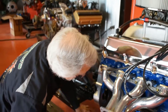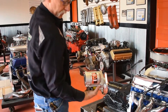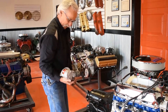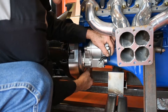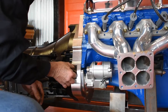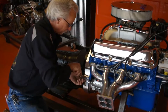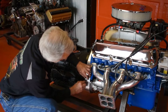That's the inspection cover, and now for the starter. That's the starter we're using — Power Master. Just buy it right from them, no modification whatsoever. We've kind of partnered with Power Master because they're an American company and their stuff tends to work better and is more consistent. The 460 starters have one bolt that comes in from the back side, so we've built our adapter so you can change the starter with the transmission in place. Since I actually work on a lot of cars, I try to make everything user-friendly. We even have this cover plate to make it look really finished.